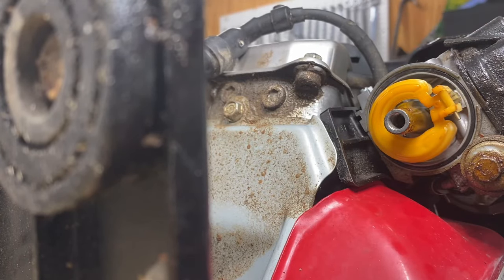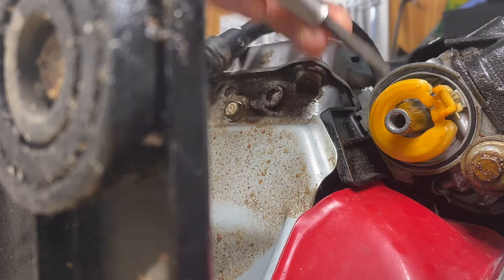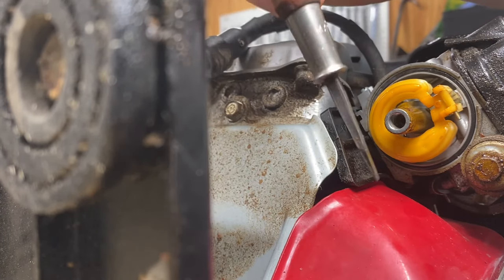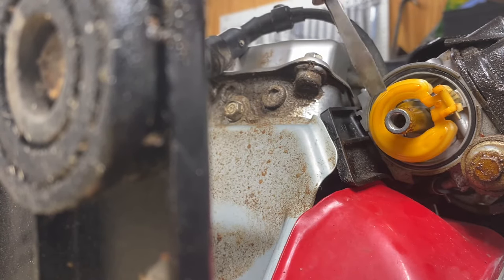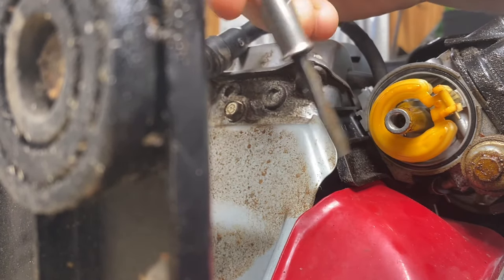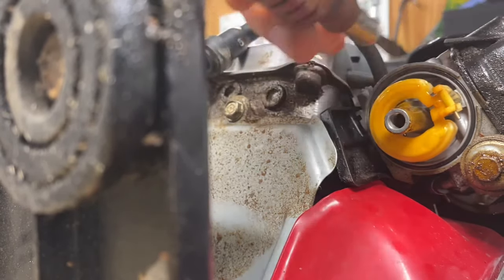So moving on - what I've done is I flipped the whole pump on its side. That way I have easier access to this carburetor for filming and everything else. Now if you do this, just make sure to flip it on the side with the carburetor up and the cylinder up, so the oil doesn't rush down into the cylinder. Our next step is we've got to get to the culprit, which down inside this hole, if you'll peek in there, is a jet - it's your main jet of the carburetor. You need to take it out. The main jet, you can get it out with a flathead screwdriver - it is threaded in there on these Honda carburetors so you can actually work on them. You want to get a flathead screwdriver as fat as you can down in here, not a super skinny one. I did lie earlier - we do need a screwdriver for this job and not just a 10 millimeter wrench.